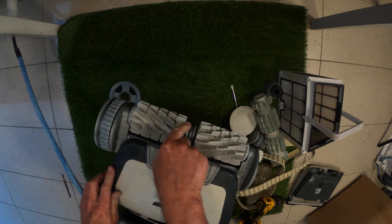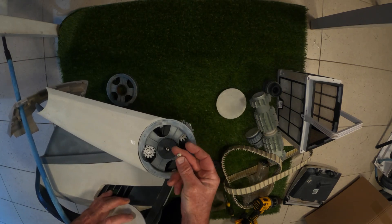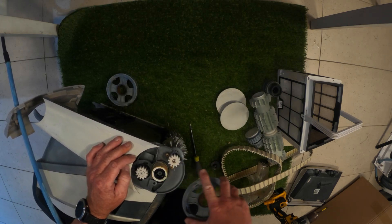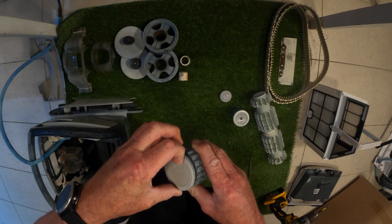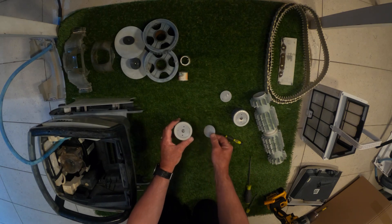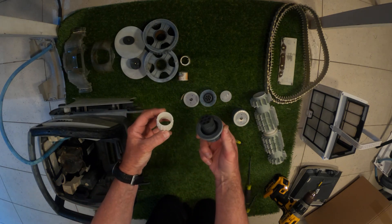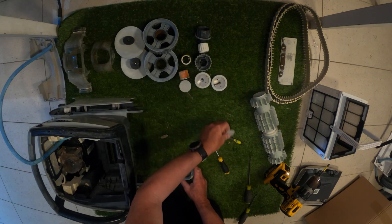You can replace the whole brush assembly, which I'll do in a moment. Here we have a gum nut caught in the gears — that can cause play, which then causes wear on the other drive gears. If you're careful, you should be able to just prise the hub up with your fingernail or a small screwdriver. Be gentle so you don't break those little tabs. These come apart easy enough, and you can see there's quite a bit of wear — it feels very rough. You can replace these bearings, bushings and wheels. On a good quality machine, you should be able to strip it down into its component parts.